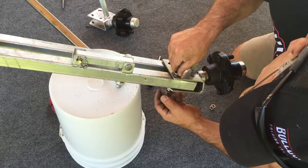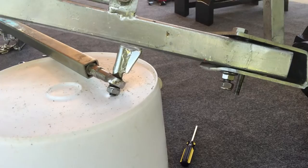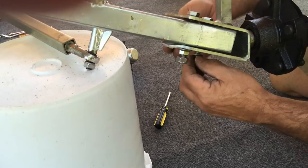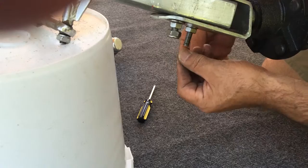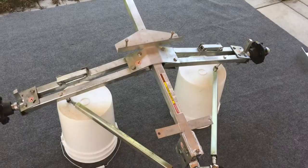It's really important that you have the flange nut on the bolt in the slotted adjustment hole directly against the underside of the axle assembly without any washer in between. On the pivot bolt, install a washer, then the hex nut, and tighten it finger tight against the bottom of the axle assembly, then thread your lock nut on. You've now got both axle assemblies installed — do the same for the other side.